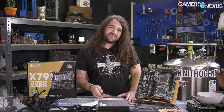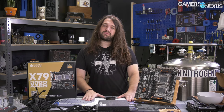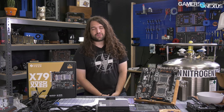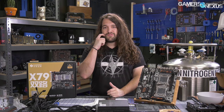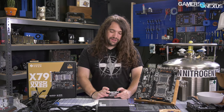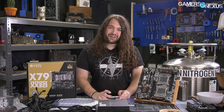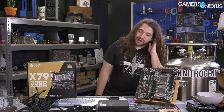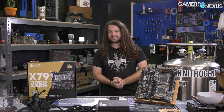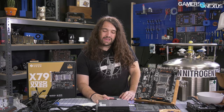So that's the build. For gaming tasks, obviously it's not the best. For Handbrake transcoding, it's really good — we just run Handbrake in the background all the time, and it's a lot faster than the 8086K overclocks we used to run it on, because it actually leverages all the CPUs. With 24 threads on each CPU, we've got 48 — we can compress the hell out of our videos we don't want taking up space. It works out very well for that. But again, you'd be better off with modern parts at about the same price once you count everything we had to buy or ask for to do this. Still, it was a lot of fun, and we have ideas for custom modifying the enclosure or doing a cool liquid cooling build.